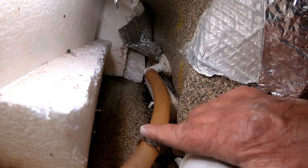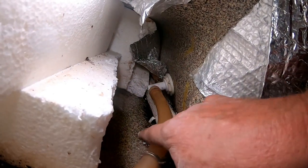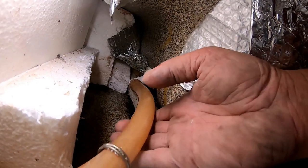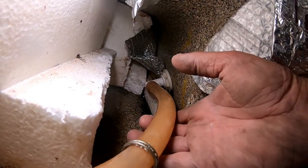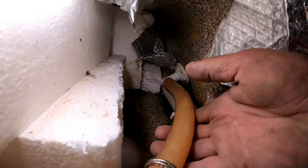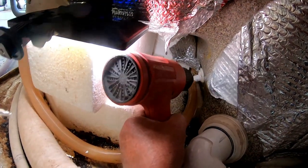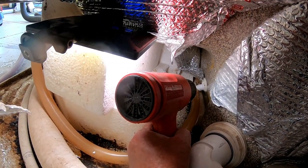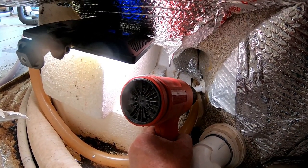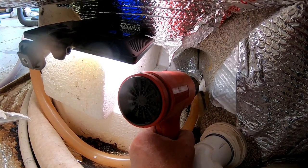I've pulled the hose clamps off. As you can see, the jet is just not tight — it moves all over the place. I'm not just going to be one of those guys that tightens it up. I'm actually going to pull it apart, put a little silicone on it, and screw it back together so when it goes to a new customer I won't get a callback. Heat gun in hand — all you're going to do is heat up the tubing a little bit. After a couple of years, these tubes get real rigid and stiff. Heat them up with a heat gun and they become pliable again so you can pull them right off.